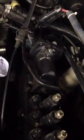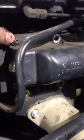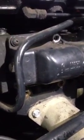Pull off the AFC housing and the aneroid spring, and cut that fuel plate. About to pull this AFC housing, which stands for air fuel control, and there's a safety bolt you have to remove. I use a chisel to do that.